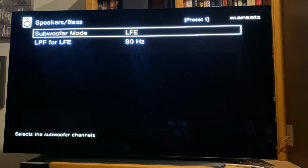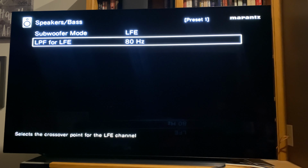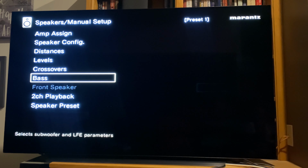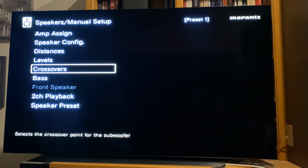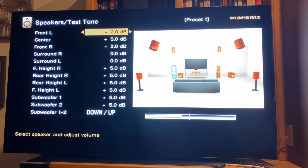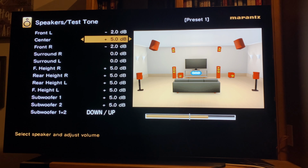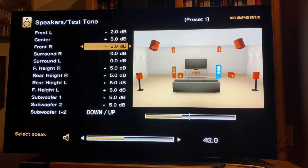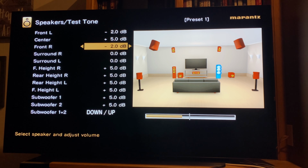And of course, the reason I believe the best setting for your setup is setting all of your speakers to small and letting your subwoofer handle the bass is the simple fact that your subwoofer can handle low frequencies and produce a deeper thump, a deeper bass tone than your speakers can produce. On top of that, depending on your speaker and your speaker crossover settings, your speaker will still produce some bass. It's just that the majority of the lower frequencies will come out of the sub.